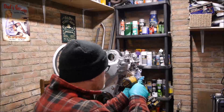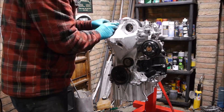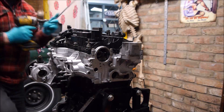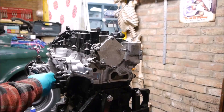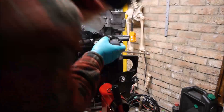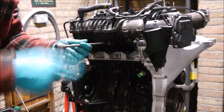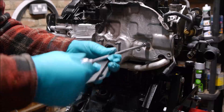It's probably easier if you had both engines next to each other and just transferred them across. I'd actually taken them all off because I had a view to rebuild the engine, then realized it wasn't cost-effective. So I'm just putting all the cam sensors on here now - you've got the position of where the cam is. Cam cover needs to go on, inlet manifold. Then the water pump going on, pipes for the water pump, some sensors on the back of the engine. I take lots of pictures beforehand so you can follow the process and put them back on the new engine. Should take about an hour to transfer all the bits across.